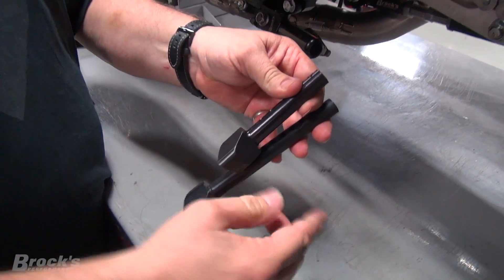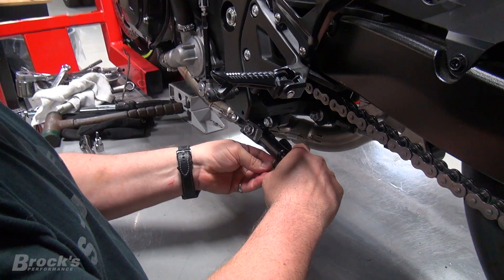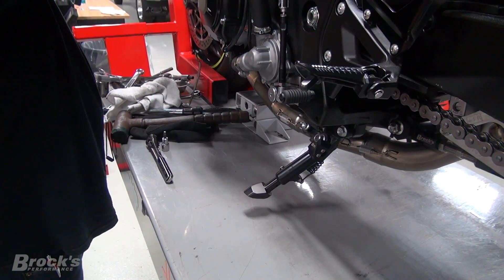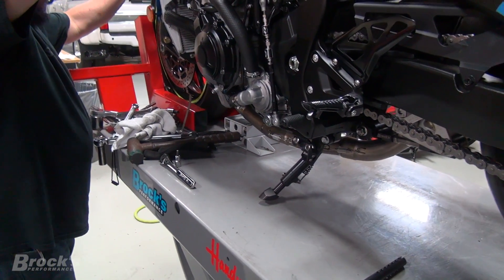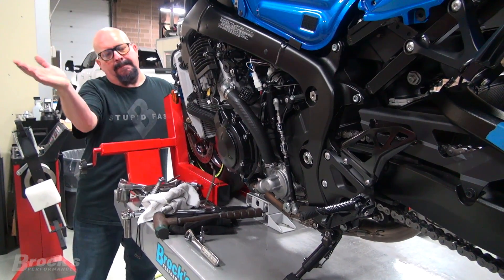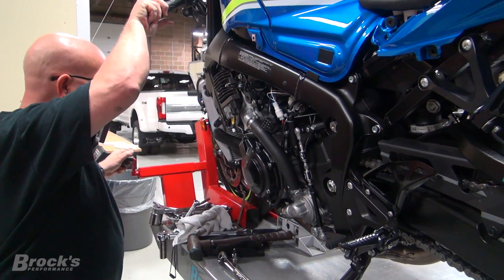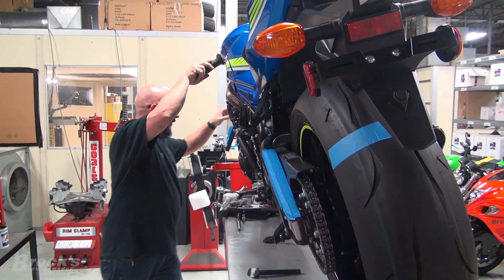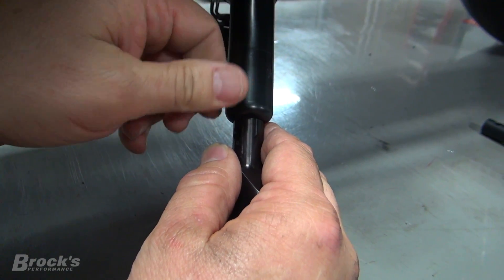Since we are lowering the bike, I've previously loosened this. I want to make sure you guys understand - we tell you in the instructions to Loctite these screws. Blue Loctite, a medium thread locker, is just fine. Because the problem is if you don't Loctite it, the bolt falls out, your foot falls out, and then you're stuck when you stop and go, hey, where's my stuff? You can see the difference - this is the track version, this is the street version. I'm going to go ahead and put this on. So that's really short - we're going to test and adjust the length.